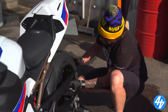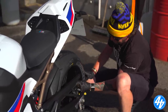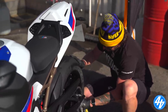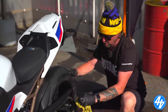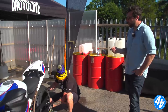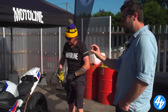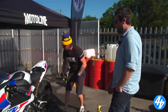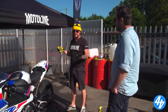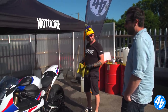The chain's got some wear on it. Do you prefer chain lube or chain wax? For sports bikes this time of year I've been putting lube on the bikes. For adventure bikes, the ones upstairs will have wax on them - they're potentially going to be doing more adventurous stuff, coming across more water. Wax is less flingy and stays on longer, as long as you let it bed in. If you put it on and go for a ride it's going to fling off everywhere. You should do it when you come back so the chain's nice and hot. There's also a bolt missing here - and that's another good point about washing a bike. You'll get to know your bike and be able to spot something missing. You know where to be careful on your own bike.